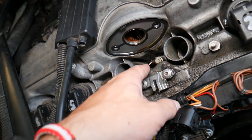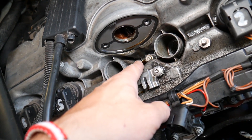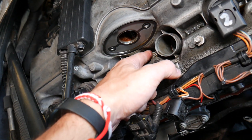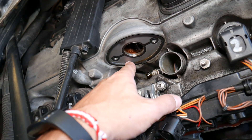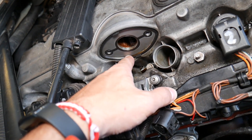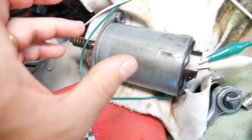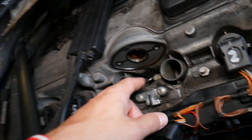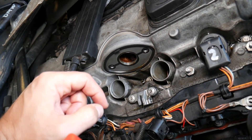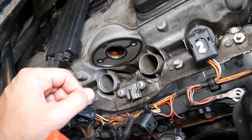If you have a leak only in the middle pocket, it could be a bad valve cover gasket with that bolt leaking, but it could also be a bad gasket for the Valvetronic motor — those tend to start leaking with age. We have a video on the channel explaining how to remove and replace one. This is your Valvetronic motor — we have it removed so we can show you. I'll try to put the link in the description below. These are the two most common causes of oil in your valve cover.